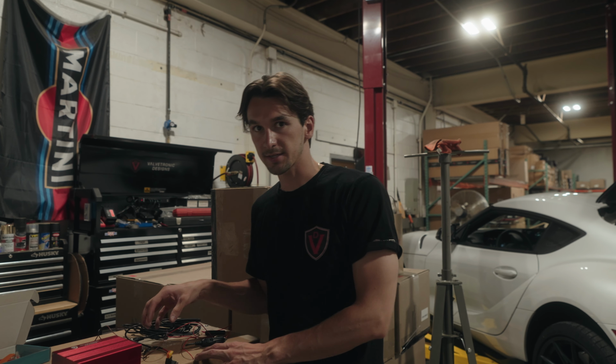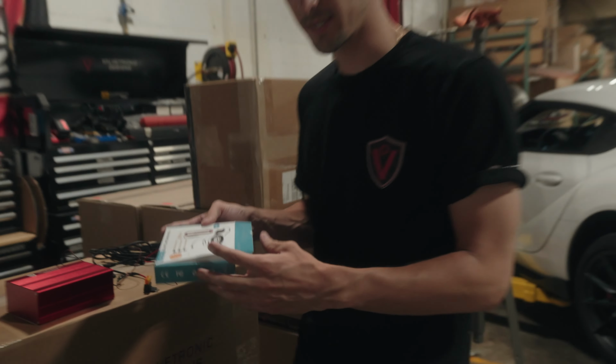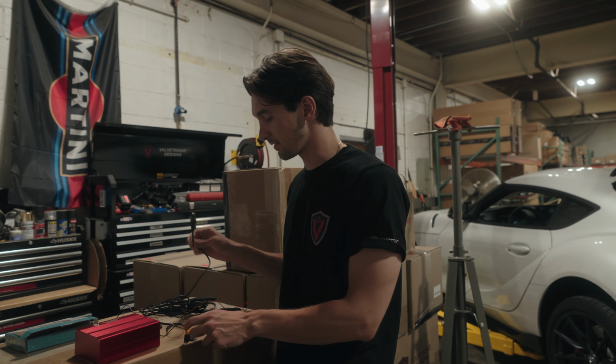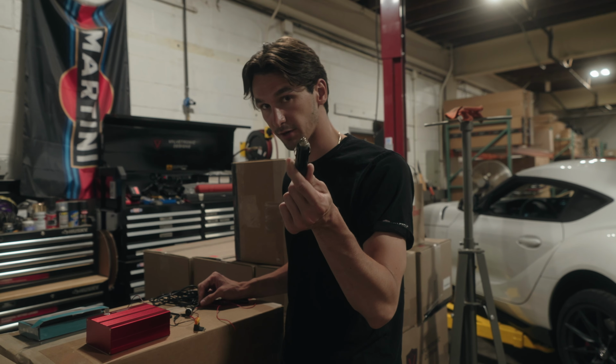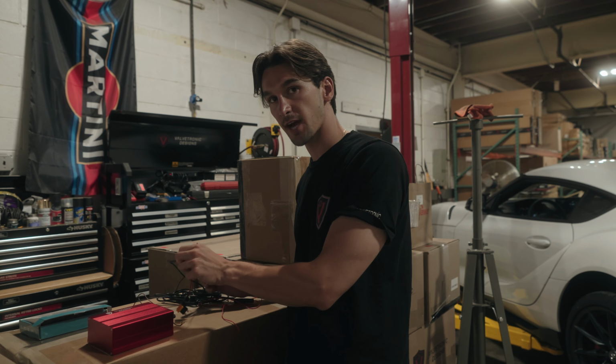Over here on top of this box, we've got everything that you will need. I happen to have this laying over. This is like a dash camera hardwire kit. And what we did is we utilized the pieces in here and we cut off the end of the vacuum control box, the cigarette lighter adapter here, and then just tied them together. So you can see in this connection here, inside this, it's just power and ground, very simple.